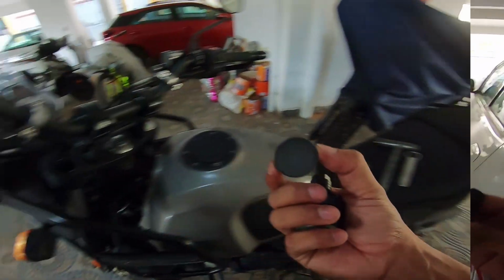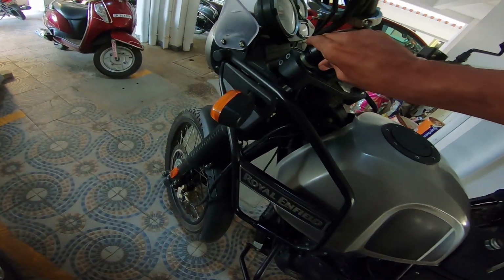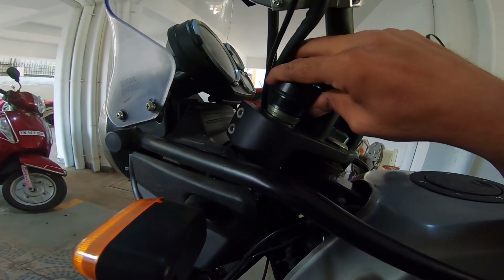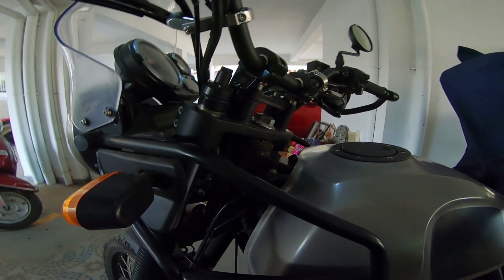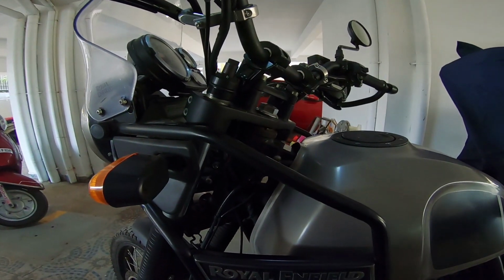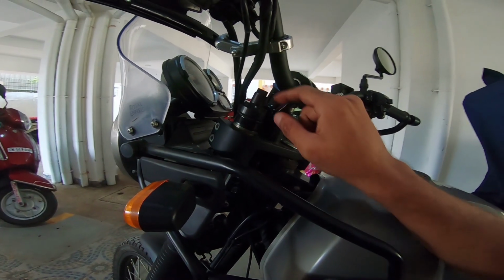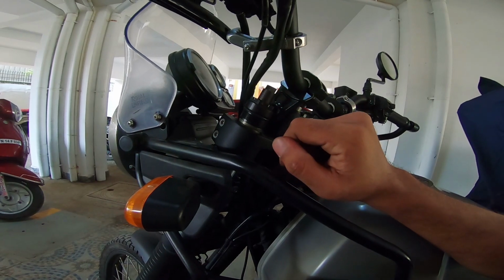this piece. So you're taking away the cap and this spacer and just inserting this. Yeah, perfect. So if you guys can see, this is how it lines up. It lines up like that. I kind of forgot how it went in. So you first remove your cap, followed by the spacer. You don't really need these two. This is going to go in. The only thing you need to keep in mind is to apply a bit of oil onto all the threads and the O-ring before you shove this in.